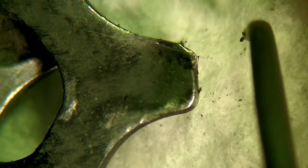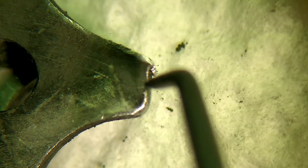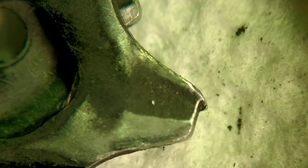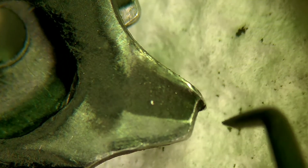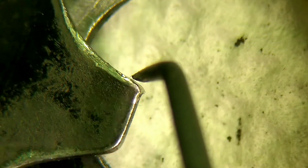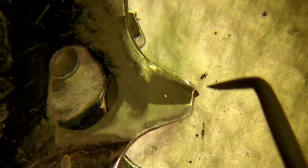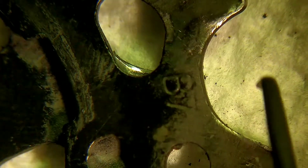The aluminum cogs on top — the larger ones — don't have this problem because of leverage ratio: you might be climbing on them, but the power transfer going into those gears is a lot less since it's a larger diameter. Look at this one right here — this is actually one of the worst ones I see. The chain was just going right over that when you put tension — you're just skipping right over it. This is something you couldn't see with the naked eye, but I put it right on the microscope and was able to see it.